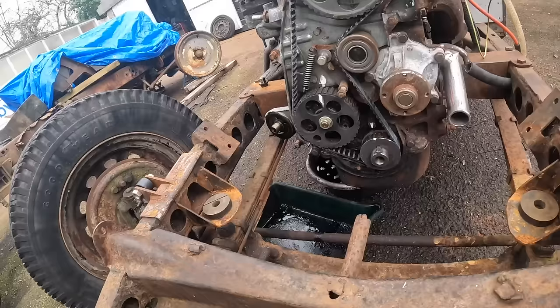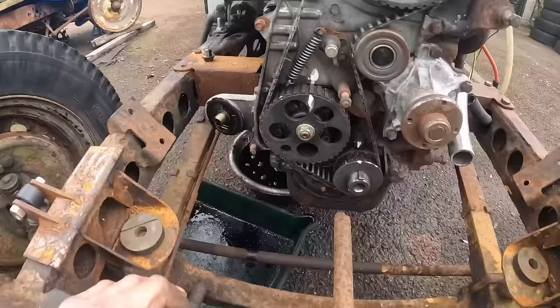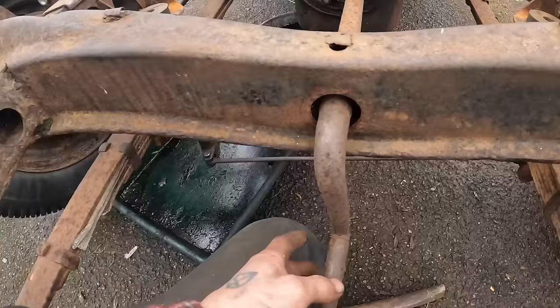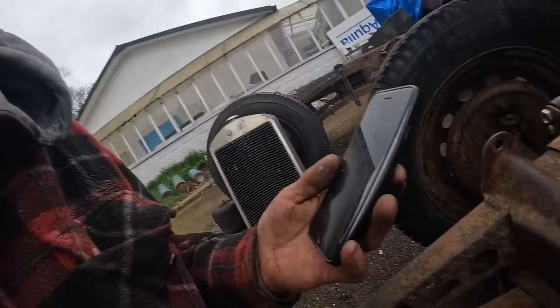What I'm also going to be doing on here — and I might do it sooner rather than later — is putting a cranking handle on there. It just gives you the last resort on reliability: if you've got a bit of a flat battery, as long as it's well in tune, wallop, off she goes. I'd have room to get the oil filter off with the engine just slightly that way. I'm thinking of having this sprung so it sits here all the time, and when you want to start it you push it in, roll it over once, and as soon as it fires it drops out. I had one on an A60 pickup once and I used it for ages — my starter motor, I just used it all the time.